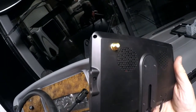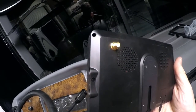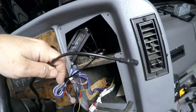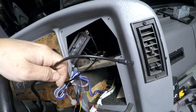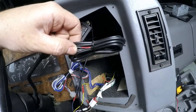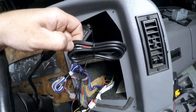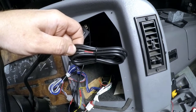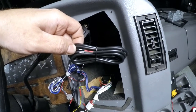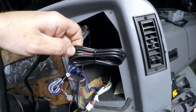On the back of the screen, make sure you screw on your antenna. Here it's mounted on the dash with the power cable coming through. I'm going to use one of the included lengths of power cable to connect to the power lines. The easiest way is to use a cigarette lighter adapter — with the stick-on mount plus the cigarette lighter you can probably have this done in about five to ten minutes.